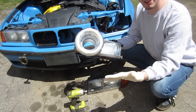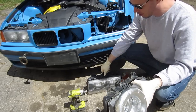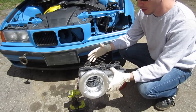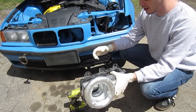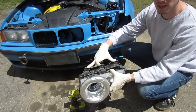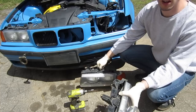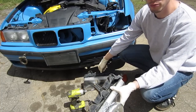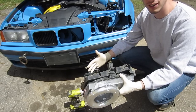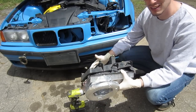Here we go, we've got our ram air intake all built and ready to test fit onto the vehicle. And again, not for you guys to worry, but I do have another headlight set that I can just pop in. So essentially my plan is to get to the track and attach these two top easy-to-access bolts. So essentially two bolts to drop this in and out whenever we go race. And then throw the stock light in on the way home. So it's still legal. Everything's still good, but now we got a sweet 20 horsepower increase because of this awesome homemade $4.80 ram air intake.